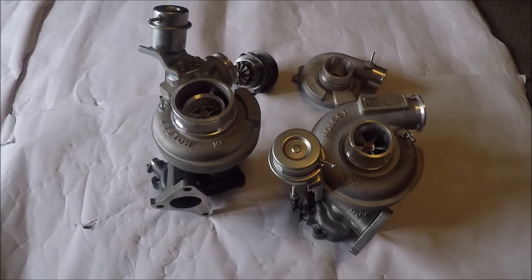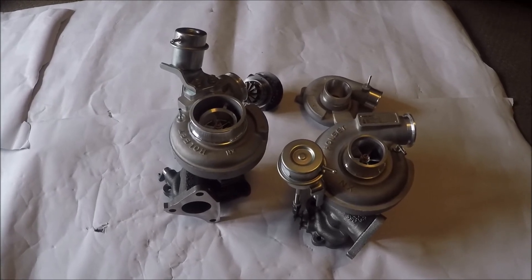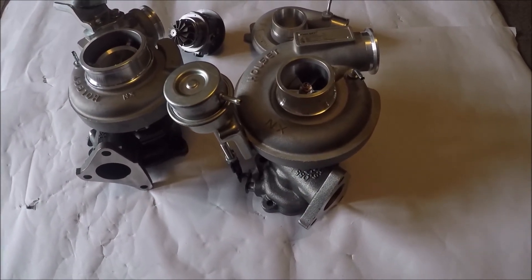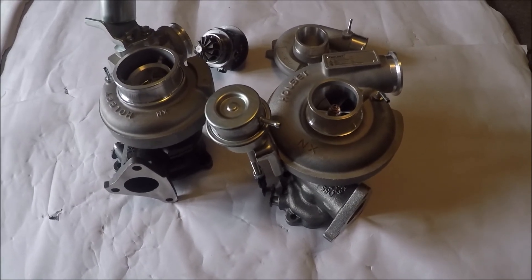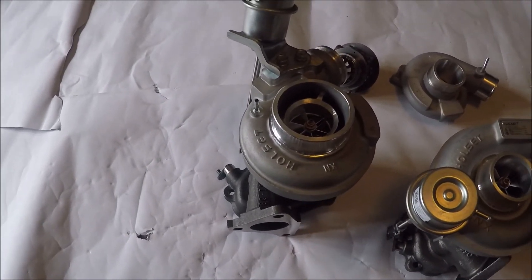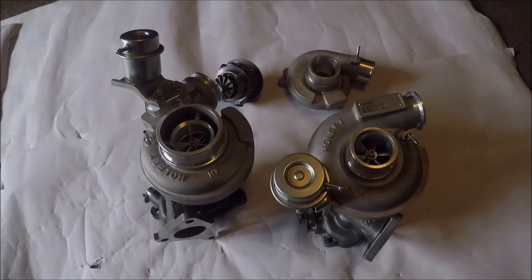I've got some compressor map comparisons I will post up at the end of this video. These things are well proven — I've seen 221s as twin turbos on 2JZs making over 700 horsepower at only 1.5 bar and spooling up from literally nothing. I've seen a little 1.6 litre indirect injection diesel run one of these and even that was on full boost by about 2,500 RPM. On a 2 litre Subaru this would just be a beast. A 2 litre would be perfect, and this on a 2 or 2.5 litre would spool up like anything — proven at 30 PSI under 3,000 RPM. They're weapons. I hope this helps and give me a shout if you want to buy one.